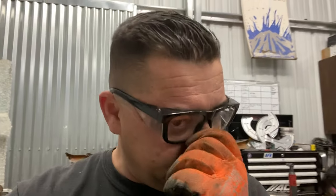All right, I had only modified the shock tower so that a 2-inch piece would go in there because I thought that would clear, but I cut it out, and even with 2-inch, it's still close. Like if they were to adjust this way, if they were to go in with the caster camber plates, it would have hit. So I took another inch out of the bottom. I'm gonna have to fabricate a 3 1/4-inch piece because it's at an angle, but I think that'll do it. I'll still be able to get the headers in and out of there, and it'll still be strong.